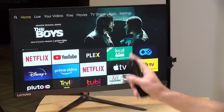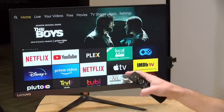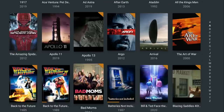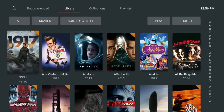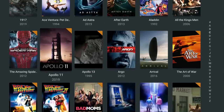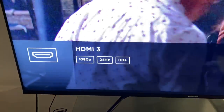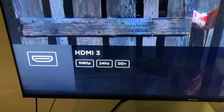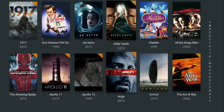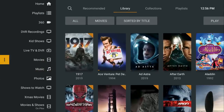It was nice to see Netflix working with Atmos audio on one of these low-end devices — Atmos works on either the Light or the regular stick with compatible hardware. For Plex users — and in full disclosure Plex is a channel sponsor — the live TV feature worked fine and de-interlaced channels properly, which older Fire TV sticks didn't do well. Running a Blu-ray MKV, the TV properly switched into 24p mode, but lossless audio (DTS-HD or Dolby Atmos) was not passed through even with that setting enabled.